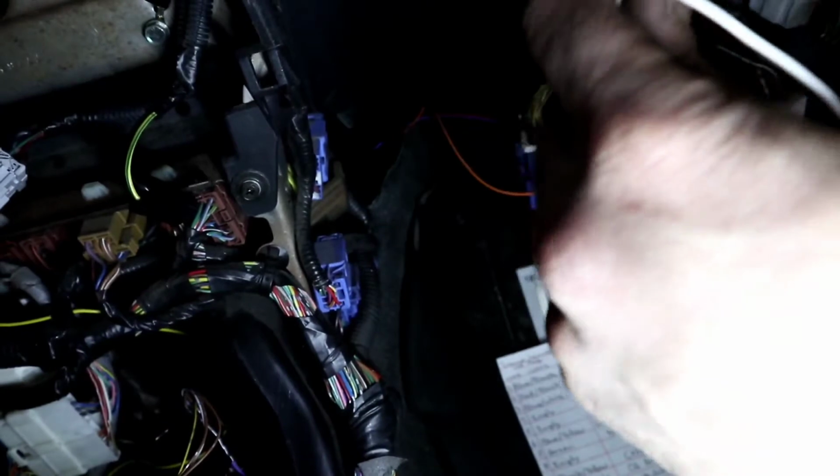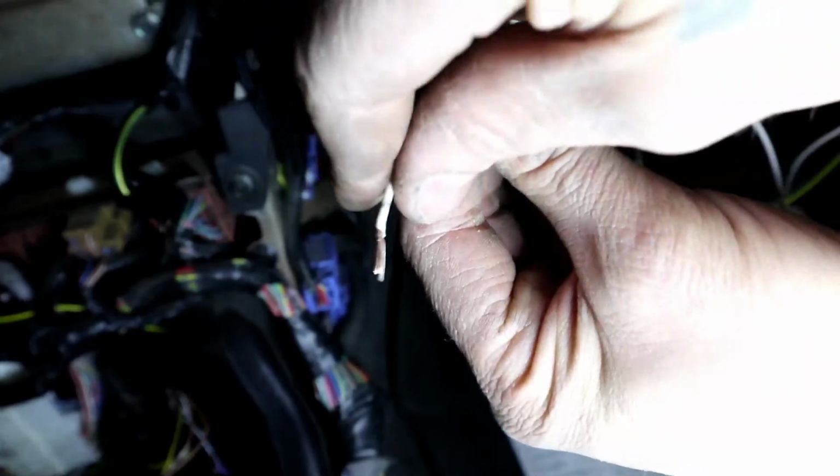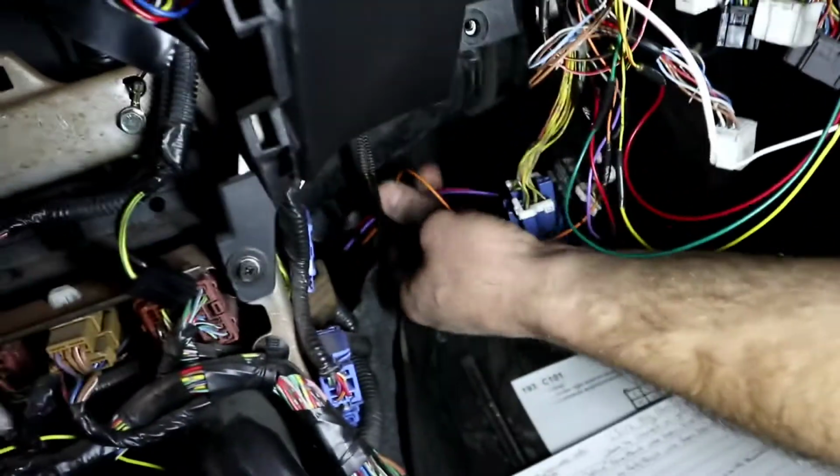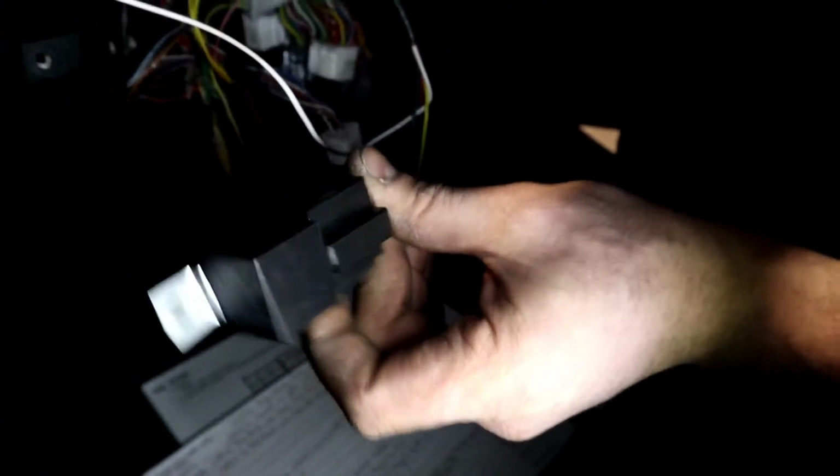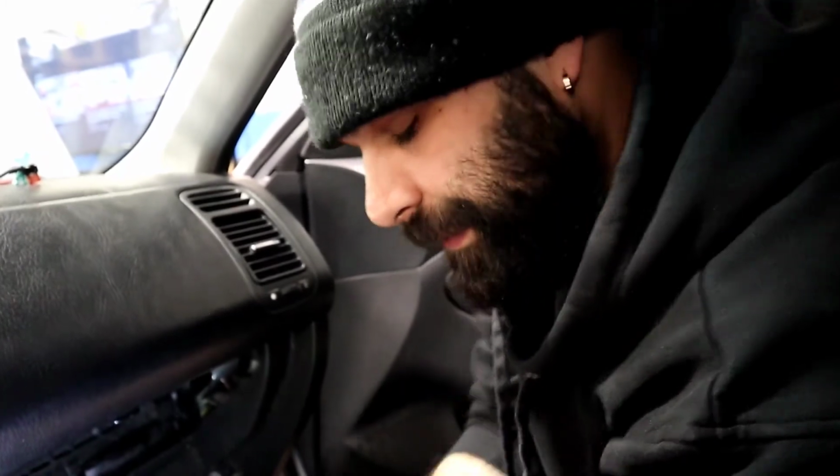That wire there sounds a bit complicated, it really isn't. That wire there, along with this other wire, there's 2 white wires. Why it states here, connect to relay plug, it's the relay plug for the primary O2 sensor. I haven't shown you guys yet what this is. So this is going to come later on when we're wiring up the primary O2 sensor. So this white wire for number 15 right now, you can leave loose. And you're going to come back to it afterwards.